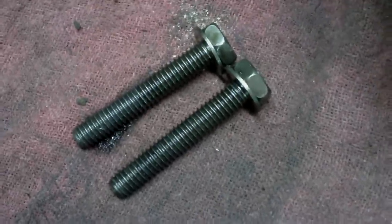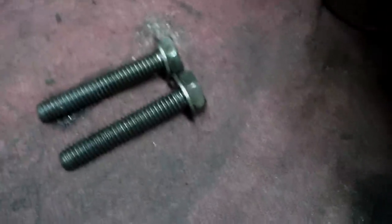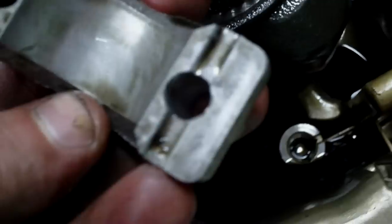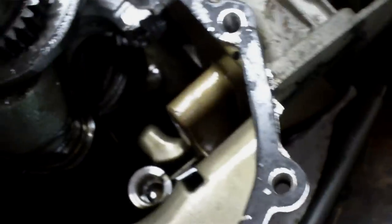There's the two rod bolts out. Now on some Briggs, one is shorter than the other one. The torque specs are different on them. They're a lot easier to torque. Now we're going to pop the end cap off. I just gently tapped it with a screwdriver and it came off. Now you can check your bearing for wear. This is pretty good — just a few light score marks. The rest of the rod should look like that too. I'm going to get the crankshaft out of the way.